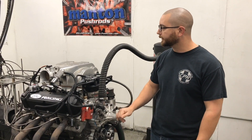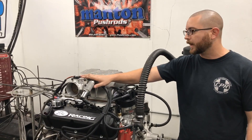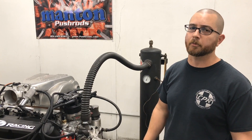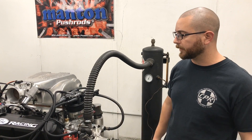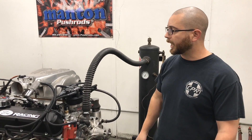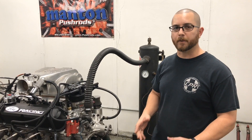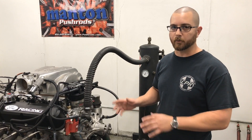We're back. This time with the Holley Systemax intake. Nothing's changed — we have the same 75 millimeter AccuFab throttle body, but we did put on the Holley Systemax. The lower has been port matched to a set of 185 heads. We have this intake here at the shop because a lot of customers will want us to dyno test their 347 or 331, and the most common one's the 185, so that's why we have it port matched to the 185s. Like I said, these are 165 heads. The customer decided to keep the GT40 ported lower and the tubular upper for last, because eventually that's where he's going to run.